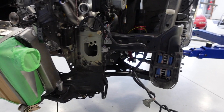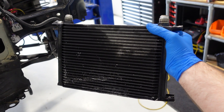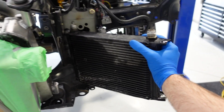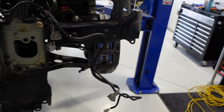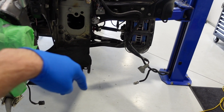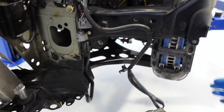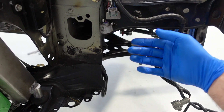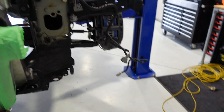We're also redoing the oil coolers — we've got an engine oil cooler and a transmission oil cooler that both need upgrading. We'll likely package them symmetrically on each side of the car. One important thing to be careful of is that while we're feeding air from the front, we also need to exhaust it out the back — something that often gets overlooked. We can't vent into the wheel arch area because that's typically a high-pressure zone, meaning flow would almost reverse back through the cooler. We'll probably have to figure out venting through the side of the bumper to avoid this.